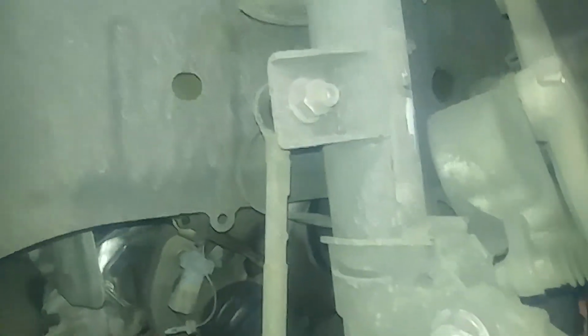Alright, so I'm done fighting with that ball joint, so I got a bolt out of here. It's like a 21mm bolt and nut, and then an 18mm nut on the top, and a 15mm bolt that goes through there. A little prying involved, but not too bad. I'm also going to take this off, 18mm nut, and probably an 8mm insert there, Allen. I'll be taking that off to give me some free play right in here. So that's the plan.